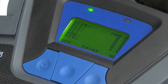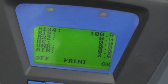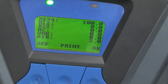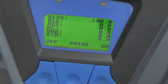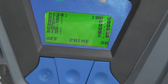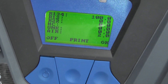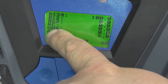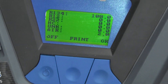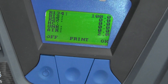Here we go. Basically what the readout says is it tells you what contaminants might be in the system, or what the composition of the refrigerant is. In this case, we've got R134A 100%, so the refrigerant's not mixed with anything else. Sometimes guys will try to — say if they don't have R134A — use an old can of R12 laying around. Some guys in the commercial industry that have R22 might charge with that. And then some of the other popular contaminants are HCs or hydrocarbons — so if someone tries using propane, which is a big no-no — and then unknowns, any other junk.